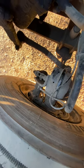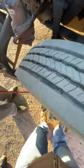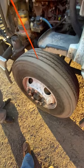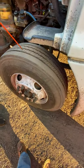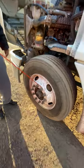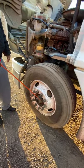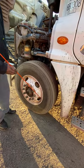The tire, inner and outer sidewalls, no ABCDLs. ABCDLs are abrasions, bubbles, cracks, cuts, damage, and leaks. The tire itself is proper amount of security to the rim. For the steer tires, minimum tread depth is 4/32 inch. Tire inflation is 110 PSI. These tires cannot be recapped and they cannot be re-grooved. The rim has no cracks, no illegal welds. All my lug nuts are present, with no shininess of thread or rust trails which would indicate looseness. Our hub seal is filled to the proper level and not leaking. Our air valve stem is straight with a metal cap — no metal-to-metal contact. The valve is not leaking and it's not touching the rim.